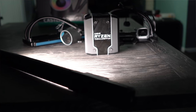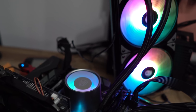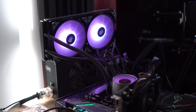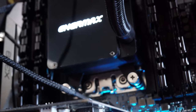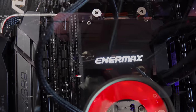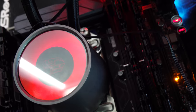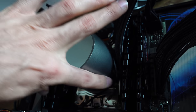All three coolers were performing really well. The Deepcool Castle 280 has RGB control, so you get that bling with the performance mixed in, and the build quality is actually really good — so I can recommend their new series of coolers even though they're not the best performing of the three. They do perform quite well and look aesthetically pleasing. The mounting kit is very straightforward. You do have to keep in mind that if the RAM slots are too close to the CPU socket, like they are in the X399 bracket, you may have to orientate the cooler 90 degrees to face north or south. That will allow you to insert all your memory across the eight different banks without touching the pipes going over the left and right DIMMs.